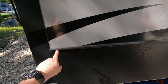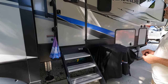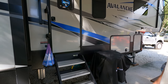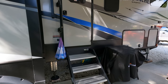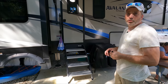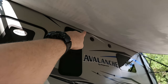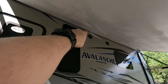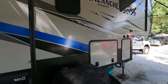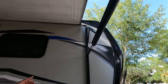More slide work — it's all sealed. We do this pretty regularly. At least once a week I'm on that roof — I'll blow it off with a blower and check lap sealant on any seal part. You probably don't have to be up there once a week, but at least every 30 days. It takes maybe 10 minutes max for that peace of mind. If you're traveling around a lot, check it when you get to your new location because all the movement from being on the road is a good time to check it too. Also recommend checking your awning — I do have a little water that comes down. I think there's a small gap between the seal and the camper that I need to silicone.